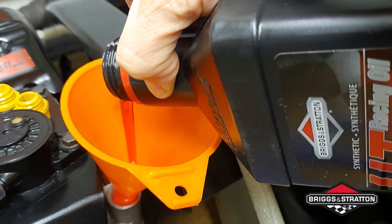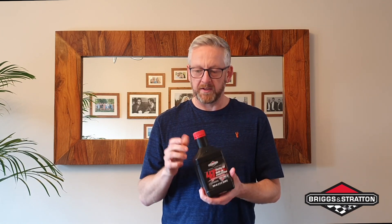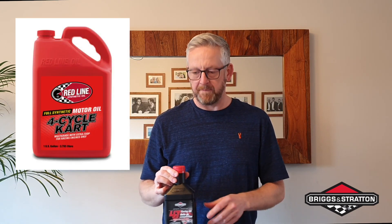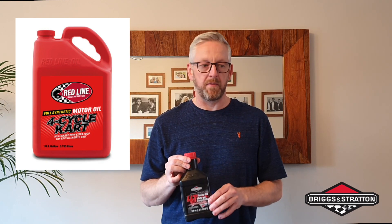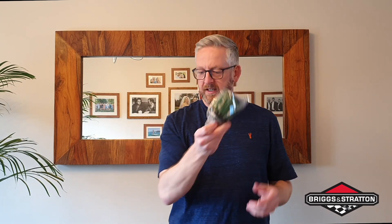The oil I would recommend is the Amsoil 4T Racing Oil, made in conjunction with Briggs and Stratton. The Gen 1 engines did have real reliability issues, and Briggs and Stratton reached out to Amsoil and said they had some specific needs - can you help us? I've run this for five years in all of my new engines and I've never had a problem. I understand there's also Redline oil - I'll try and find a clip and put it on screen - and a lot of our members have run that for multiple years with no issues. But these engines must run on one of those two oils. I've seen a few club members say 'oil is oil' and put different oil in, and unfortunately their engines have killed themselves.